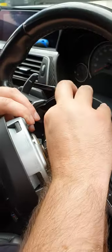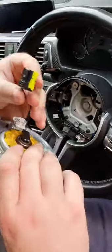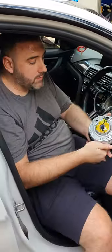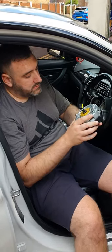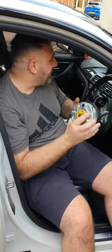A lot of the time you can do it using your fingers. If it's a bit too fiddly and you're a bit ham-fisted, you can slide your screwdriver in. It's a spring-loaded clip. Your airbag — as mentioned earlier, people worry about it. There's a detonator inside here which is electronically activated. It will project a bag through the surface of the airbag to inflate and stop you headbutting the steering wheel. As long as you're cautious there shouldn't really be any need to worry too much. It does take an electrical charge to discharge. If you drop it or it's exposed to heat, the chances of it discharging are slim to none. You sit with this in front of your face all day when you're driving — it won't just randomly go off. Don't take the mick with it, but don't worry about it too much.